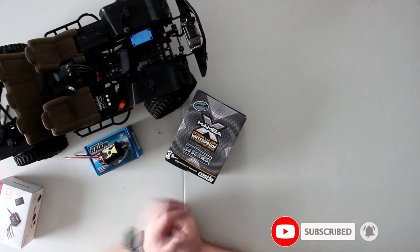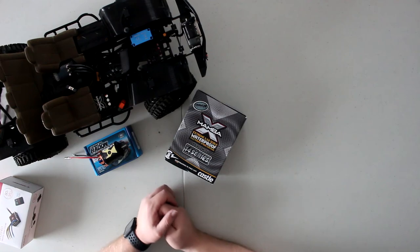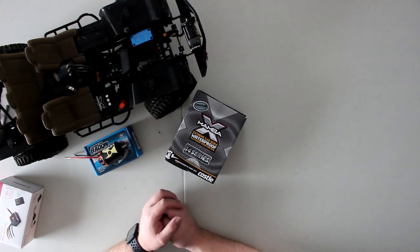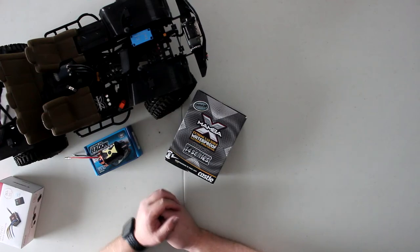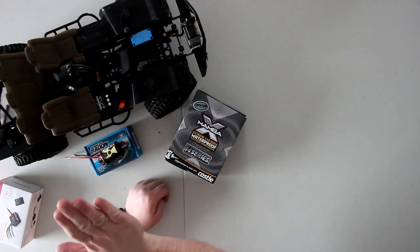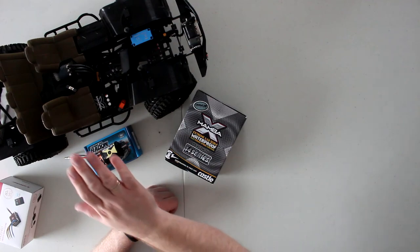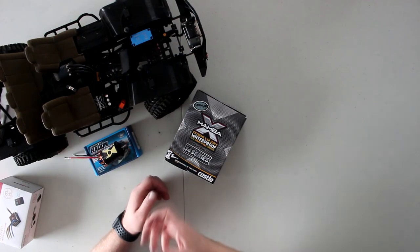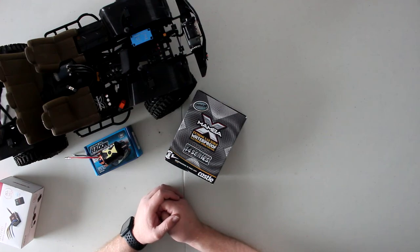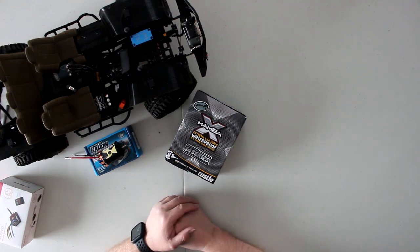That's the basics of brush versus brushless. I'm not saying don't go brushless — there are tons of options. Hobbywing makes the AXE version and they're great too. One thing I don't like about the AXE is the drag brake is automatic. Giving it one blip of throttle activates it, and if you're barely going slow and let go, you have to blip your throttle to activate it. But besides that, any system can work — they're awesome.